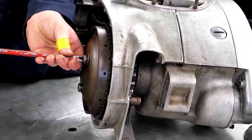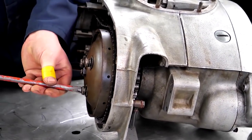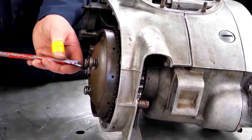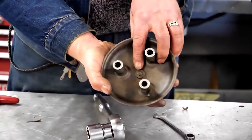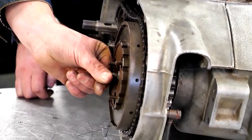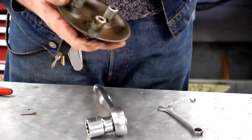We give customers the option of our aluminium pressure plate to replace this one — a bit more sturdy — and that has a thrust roller bearing in the end. This is the adjuster; you just have a rod coming through from the other end of the gearbox. That's what happens when you pull your clutch cable — it presses onto this hardened pad to lift the springs and free the plates.